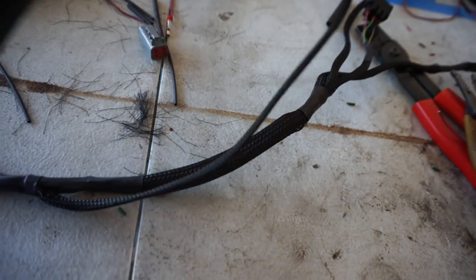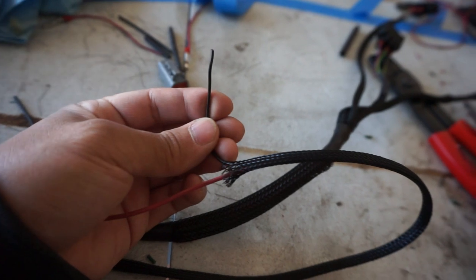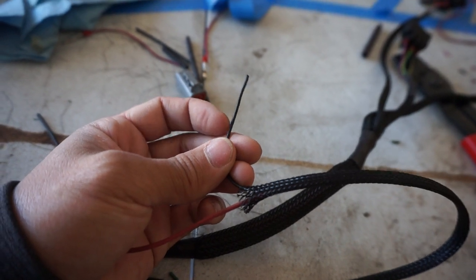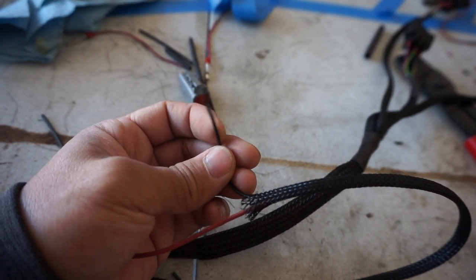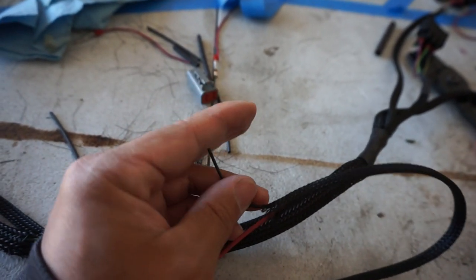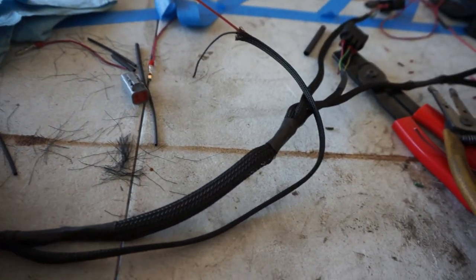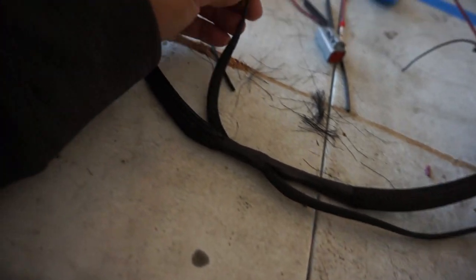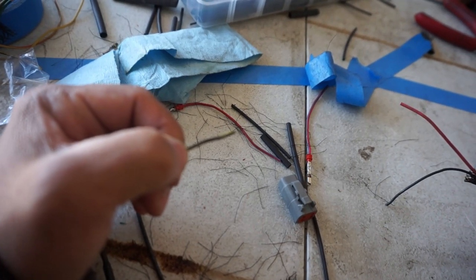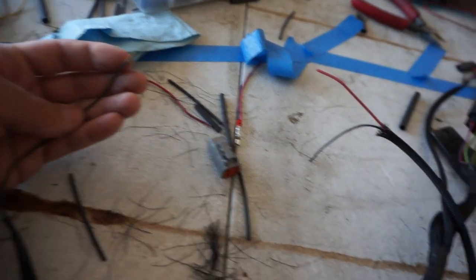This black wire — everyone's going to think that's the negative. It is not the negative wire. This is for the rev counter. This one's going to replace your RPM gauge wire to the ECU, so you're going to have that cool sweeping action for your RPM gauge. And then there's another wire that branches off — it is this other black with yellow. This is going to be your ground wire, grounded somewhere on the block. This is the ground for all grounds for all the coils.